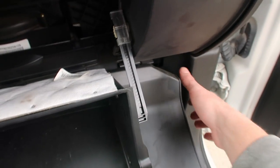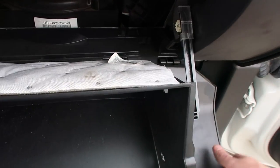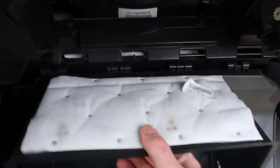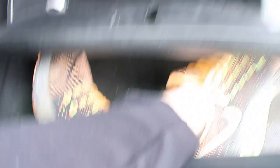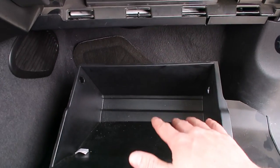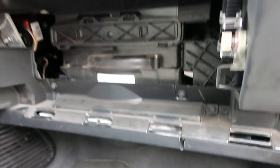The glove box is attached back here by multiple five clips that are set on a round bar. You just take it and you pry up. When the glove box is down you want to pry up on it and that will get you loose. One thing that I learned while doing this: take all the stuff out because it falls out on the floor and you wind up moving it anyway. So save yourself a headache, take it out in the first place. But here's the bar that those sit on and all it is is some little clips that you just have to pull out. Glove box out.